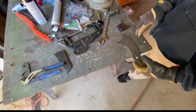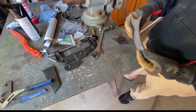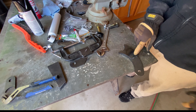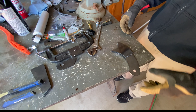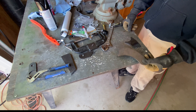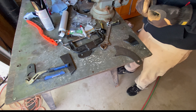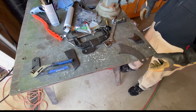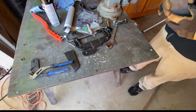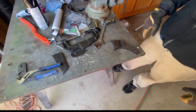I'm going to make the lower mount using a banana-style axle mount I had on hand. All I did was cut a little bit off, cut it right there, bent it right here, and that's how I made this bottom mount. Obviously this isn't the most refined solution - it's going to work but it's just temporary until we figure out what kind of setup we want in the front. This'll get us by in the meantime so we can at least get it rolling, drive it, and enjoy it until we sort that out.